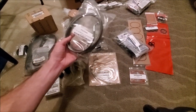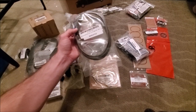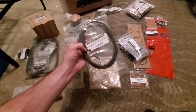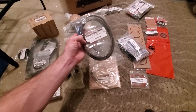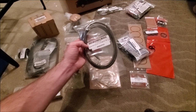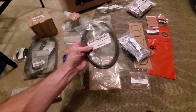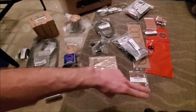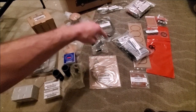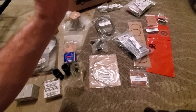Since we have everything out of the car, I decided to delete some lines. I got this stainless steel line that goes from the clutch master all the way down to the slave — all I have to do is bleed the slave and that's how I can bleed my clutch system now. This was about $50, and it lets me delete that line that runs down the passenger side frame rail.